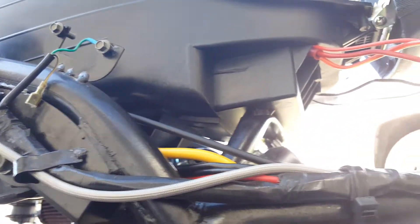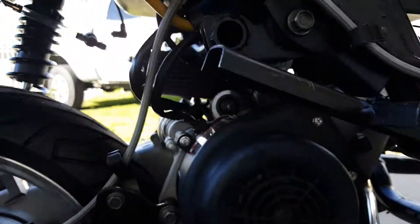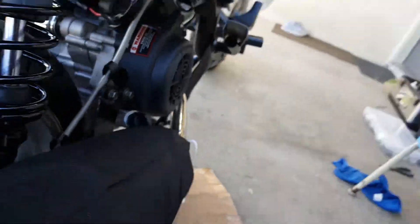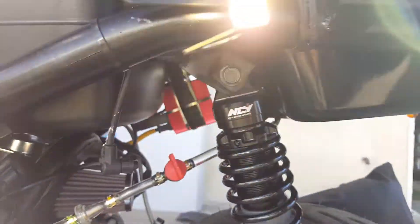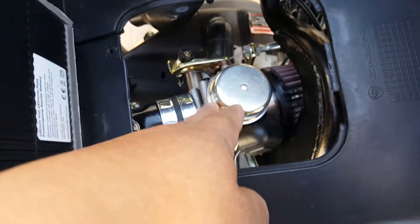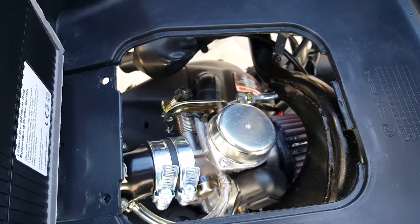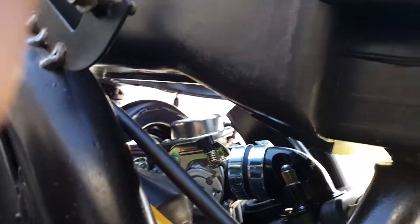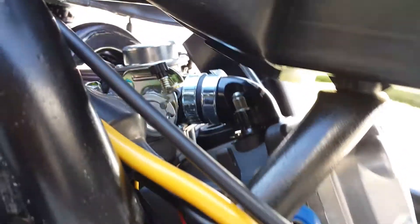We're going to go ahead and bolt this on, wire up the headlights and the tail light, and then we're going to fire up the engine. I know I've been anticipating firing up the engine — that's probably the last thing I want to do right now until all the safety is rationalized. But I do want to put all that cool stuff in. Then we're going to turn on the fuel line — so you can see the fuel line. What's great about this is it has direct access to the carburetor. Some scooters depending on the carburetor might not even let you close your seat cover, so some people have to modify and cut it open. This was awesome — I still have some slack there. So even if I want to put a PWK carb where the throttle cable sits on the very top of the diaphragm, I still have some room there — about a good inch. So I can still upgrade to a PWK carb and change out the throttle cable from a CVK to a PWK carb.